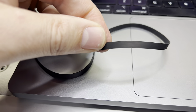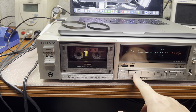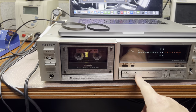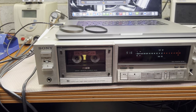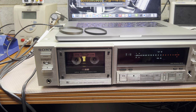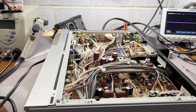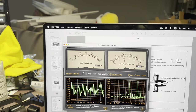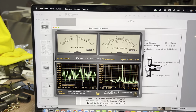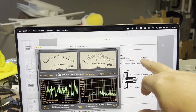Comparing to the regular rubber belt - okay, I'm done. The brakes work like a charm. That would be it - I will park and ship it back. I hope the owner will be happy. Final touches on this deck: I measured the torque on the take-up reel and it was too big - it was 65 grams in playback. So I adjusted it to be in range, like between 35 and 45 grams.